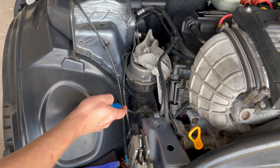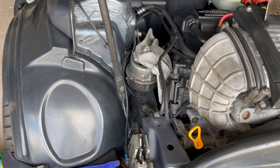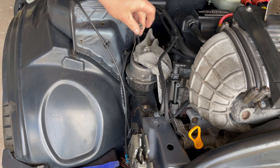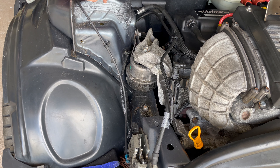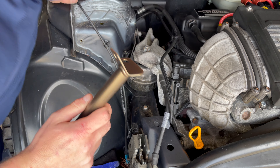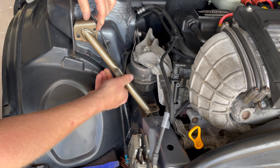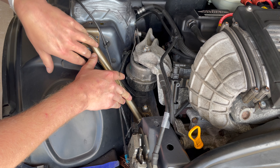If you do scratch it, just blob a bit of paint over it to stop any corrosion. To get this one in you'll have to undo this bolt here — the earthing strap just needs to come out of the way — so get a 13mm socket and get that off. Just put that up there to keep it safe. Remember to put that back on! Now it's down to personal preference in terms of orientation — the bigger section goes at the top.